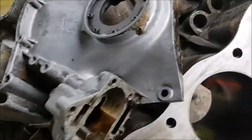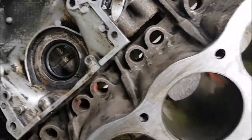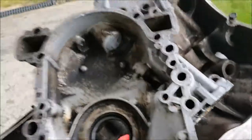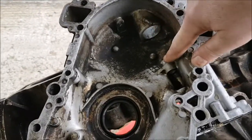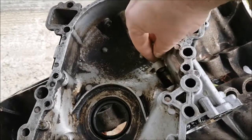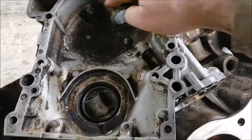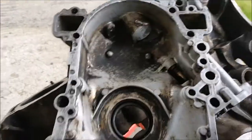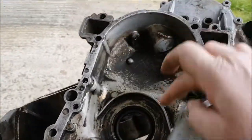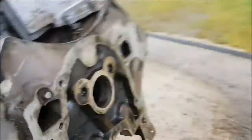There's the oil pump on the bottom of it, front seal, the crankshaft comes through there, water pump goes up here. The distributor goes in that hole there at the top, and if you look inside - there's a lot of clattering and clanking isn't there - the distributor goes in through this hole, drive comes down through there, the dog goes into this hole here. The oil pump goes up through there and drives off the distributor. There's a gear here which runs off the front of the timing set.